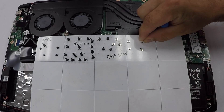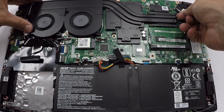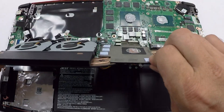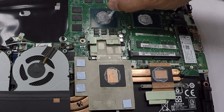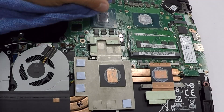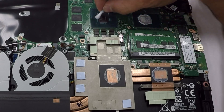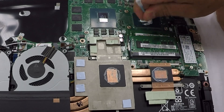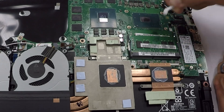You don't want to pull up too much or you'll remove the cables and inadvertently pull a cable out or break something. So gently pull up and then lay it down on its top. You're now going to want to take 99% isopropyl alcohol and clean off the GPU and CPU. Work the isopropyl alcohol all around the chip and then take a dry q-tip to pick up the remaining thermal compound. Make sure you remove all of the thermal compound before you move on to apply your conformal coating and liquid metal.